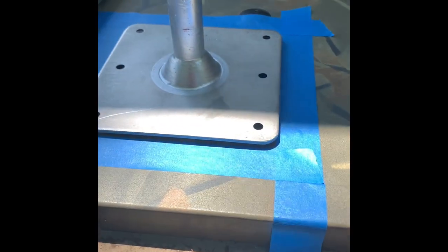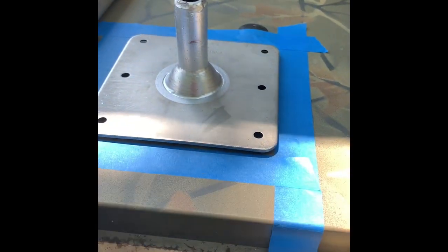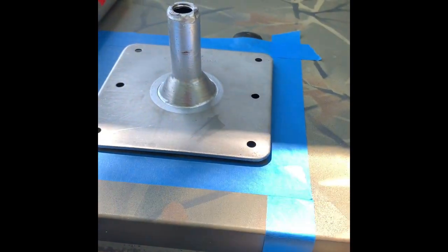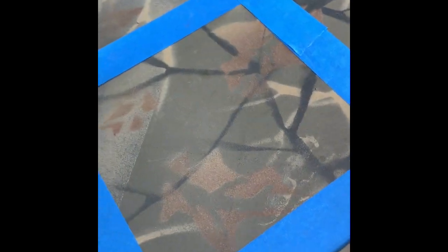It's very important to make sure you check underneath your boat. I'm glad I did that before I started drilling. There's a wall in this box underneath the deck where I was planning on cutting and I didn't have enough clearance, so the seat might not have sat flush. So I gave it a little more room and spaced it out with the painter's tape — about another inch, inch and a half over. Now I should clear that wall that's inside. It's the same way on the other side, and this side is where I have my battery. I've done the same thing and I'm going to get my center point again and then cut that hole.